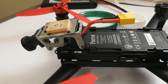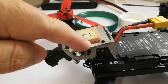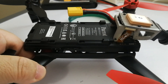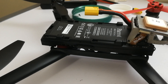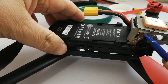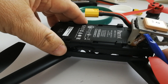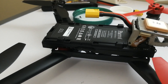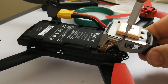I've got to say, I love working on this one. It's actually so easy to work on. Now, GPS sitting on the top here. I'll just spin it around and show you what's on the other side. So here we have a little connector here which goes to this ribbon cable there, holds it in. And on the bottom, you've just got to separate this bottom bit — get down there, use a little plastic pry tool. Now that's done. That's easy. It is a very easy little system. Only three bolts on the top of this GPS.